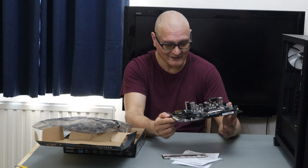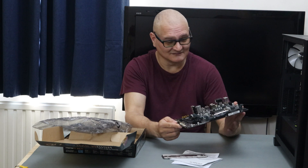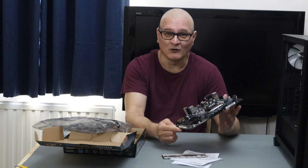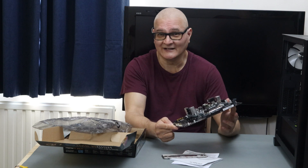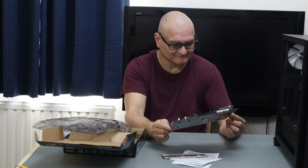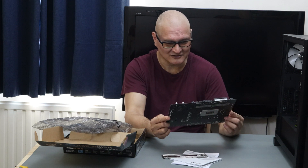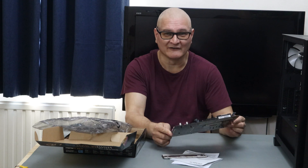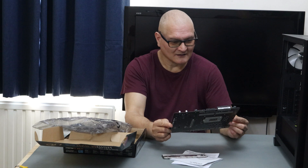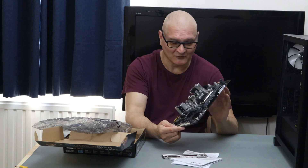As I said, we're going with a Pentium Gold, which is basically the bottom of the stack, so I don't expect it to throttle or overheat. You'd probably be fine with an i3 as well. But if you went to an i5, you might see thermal throttling on this board — unless you've got a really big fan in there. I may get an i5 to test that out.